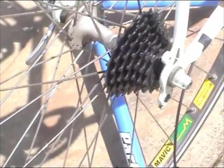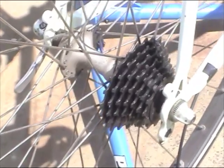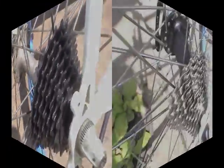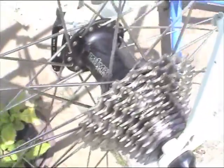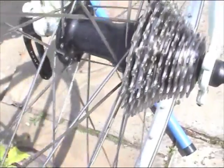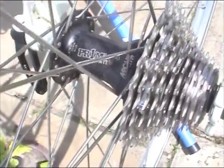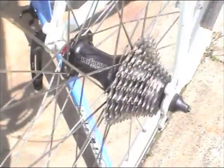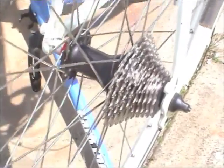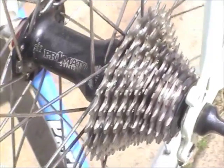First thing to do was to check a 10-sprocket cassette would fit. The original wheel hub seen here was too small to hold it, but a newer wheel had a bigger hub that used to hold the 7-sprocket cassette with a 4mm spacer. Changing to a 1mm spacer, I could fit a Shimano Ultegra Di2 10-speed cassette in fine. The width between the back forks obviously doesn't change, as it is always 130mm. The ratios on this cassette are 11 through to 25, though I think the Di2 changer can manage 11 up to 28 if you need it.